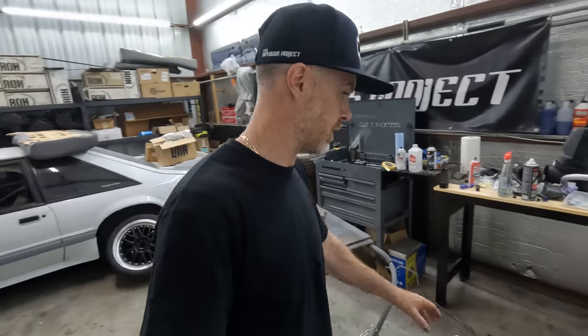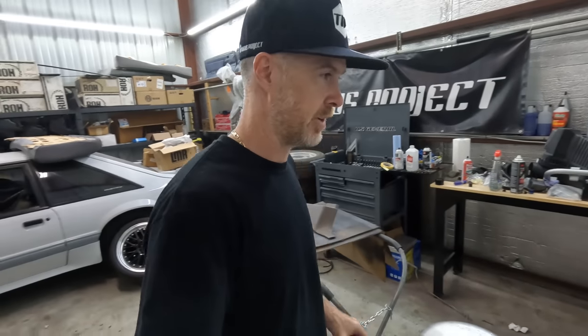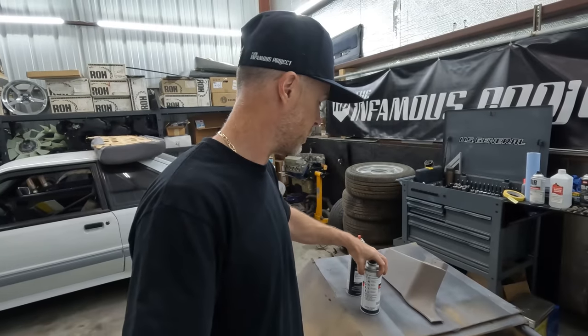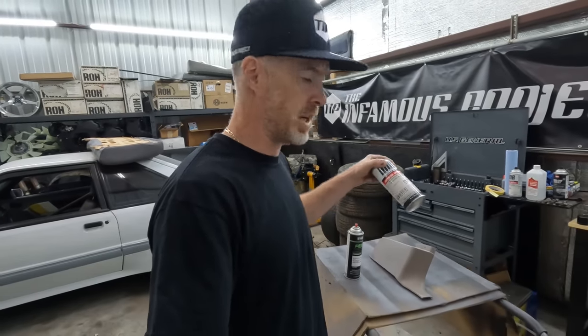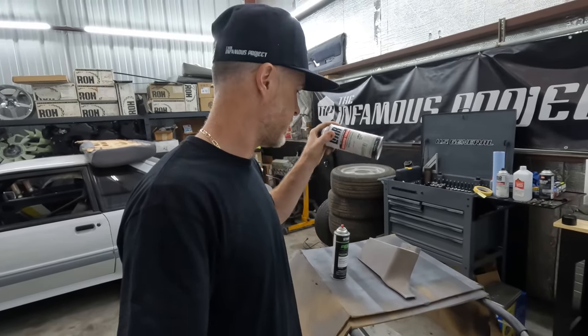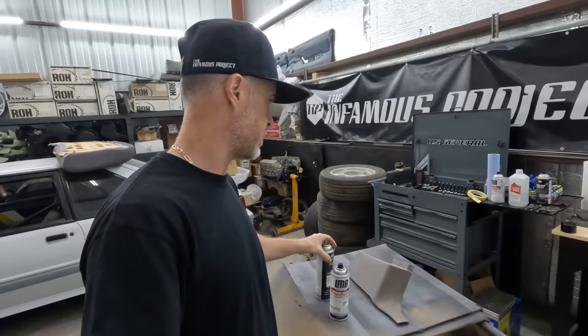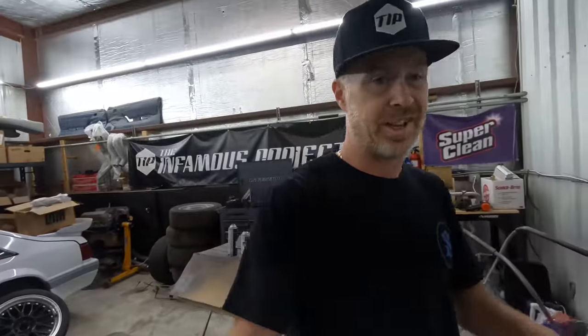And I feel bad for anybody that's got a gray interior that's 19 different colors, or 50 shades of gray is probably the reality. So the medium opal covers real nice. This LMR paint, I've been using the Seymour adhesion promoter. So all that stuff has worked out really nice so far. And I've banged some of these plastics around, especially trying to get the rear ones in around the roll cage, and it seems pretty durable, so I'm happy with that.